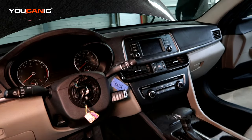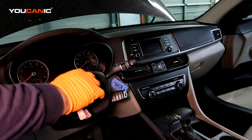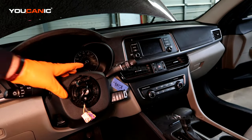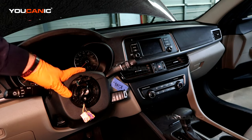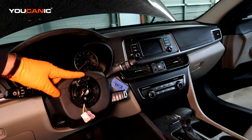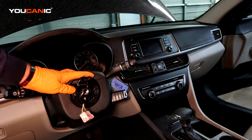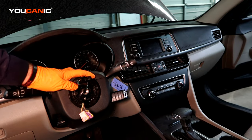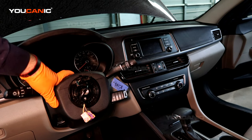To reinstall, torque the center bolt and put everything back the same way. One important thing: right here you have the clock spring. Do not rotate the clock spring. If you do, the ABS module will think your wheels are turned while driving straight and you'll have ABS warning light issues. The clock spring can also only turn so many times left or right, so if you rotate it and reinstall the steering wheel, it may stretch and break soon after. Keep that in mind — don't rotate or move the clock spring. That's it, thank you for watching!